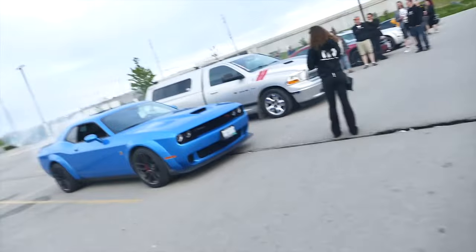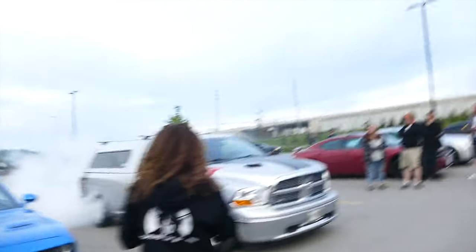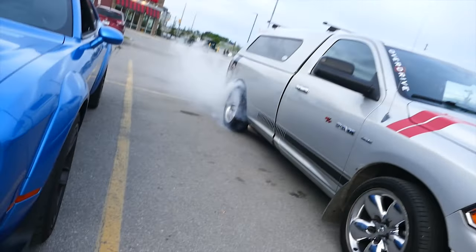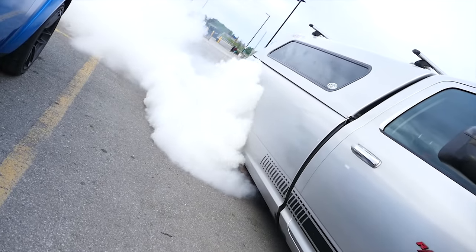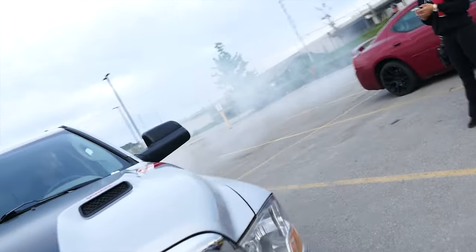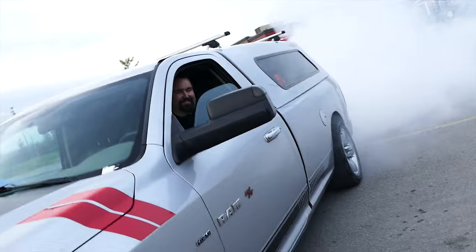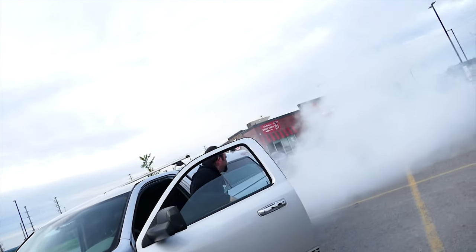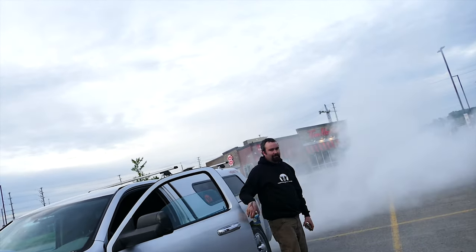It's also like, when you're building the Hemi — especially the top end — where do you stop? You don't stop. Even just in top end parts, you can port it, you can put rocker arm supports on it, you can change your rocker arms, yada yada. You can literally spend about seven grand on the heads alone.